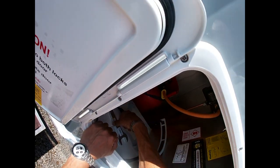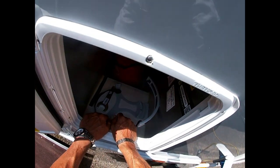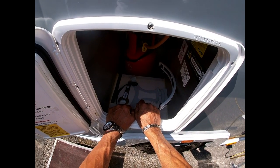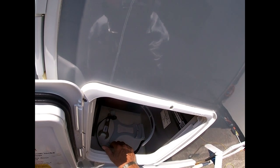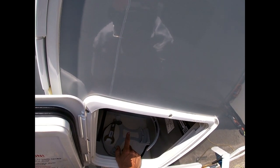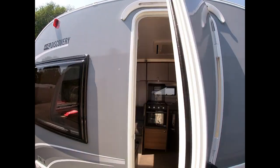One point to notice, I will leave the spanner with the van, but this is a nut with a back to front thread. So you turn that clockwise to undo it, anti-clockwise to tighten it. And we will see this because that's my test bottle of gas. A bottle of gas is something else you would need to purchase, but that's my test bottle on here because I need that ready for another demonstration afterwards. You'll notice there's a little shelf here. Up until fairly recently, they used to do half-size gas bottles. They're now obsolete, so there isn't a gas bottle that will fit on that pipe. So unfortunately, if you run out of gas in that bottle, you need to make sure that you're somewhere where there's another bottle of gas, because they don't do the half containers anymore. Your salesman or myself at any time can discuss that in more detail with you. So that's our gas leading on through back to our habitation door, ready to go inside our van.